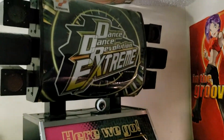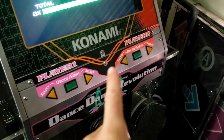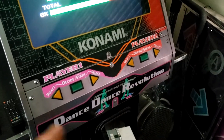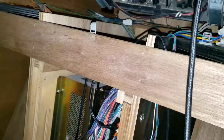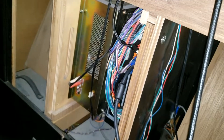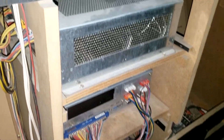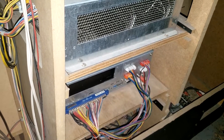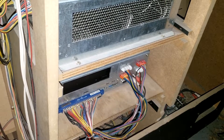This is the one we're going to be moving it to - as you can see it's a Japanese cabinet. We're going to replace this front hole bezel here, because we can't really cut a hole for the memory card slot - it'll be easier just to transplant this whole section. A Japanese cabinet typically has a little white panel up there as well, and all the boards here are vertical, going from top to bottom. In the back of the Korean cabinet, the boards are horizontal - Korean cabs may not be made as well but they're actually far easier to work on.